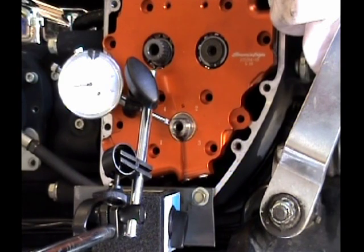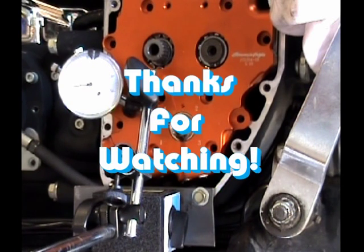Anyway, for me, I chose the chain-driven configuration. I don't have high lift. I use the stock camshafts, stock valve springs, stock valves. The chains will be fine. I just needed a tensioner that wouldn't wear out so fast. So I think this Screaming Eagle kit will take care of that for me.